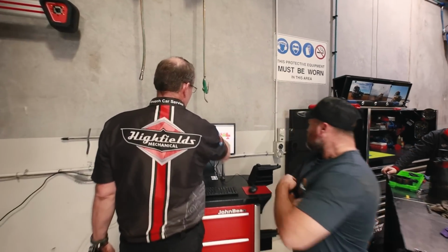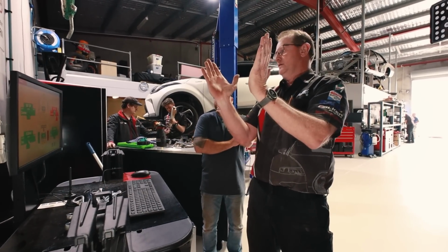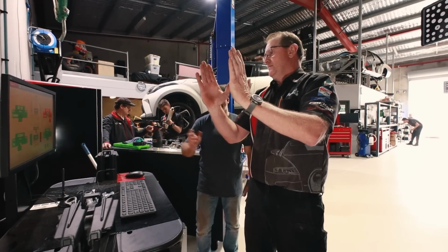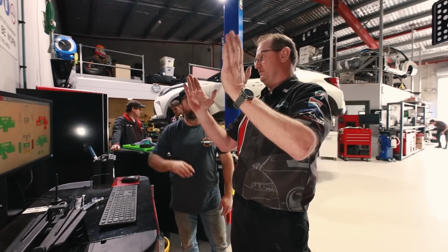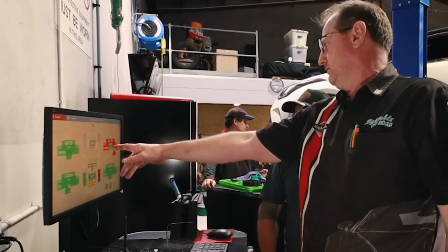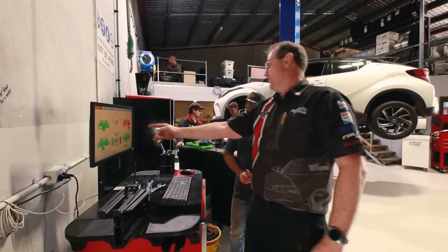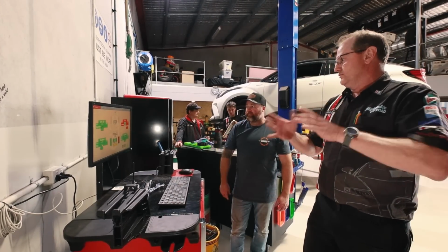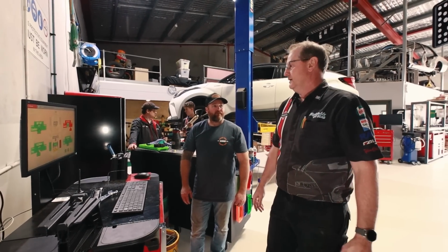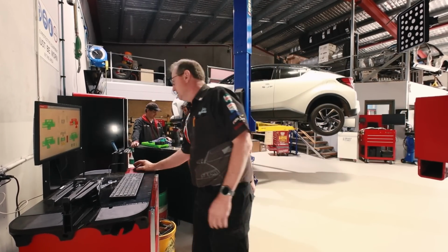Going to run that camber in positive there for now. So what's that mean? It means the top of the tyre's out. So if that's straight ahead, the left wheel's like that, the right wheel's like that, a bit further out. Ideally, we want it sort of straight. But when you sit in it, they come back in a bit. Yeah. But if I bring that back or lower that down to 20 minutes where it needs to be, we'll just lose our toe. So I want to keep the toe as close as we can. I'm sort of compromising there at the moment. So once we get the front right and we can drive it, we'll then put it back up because it's so far out of adjustment from having everything apart. And then let it settle. We'll put the canopy on it, get everything right, and then try again. So we'll get the front running now.